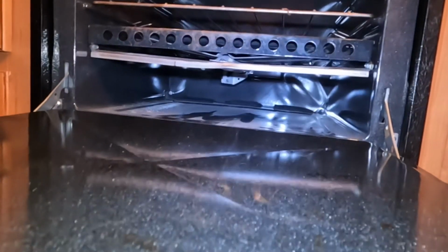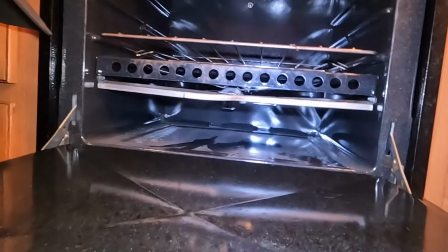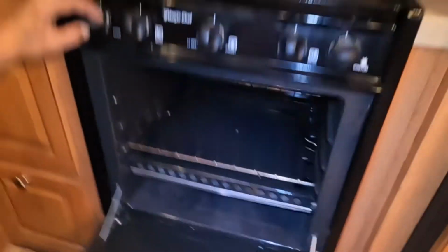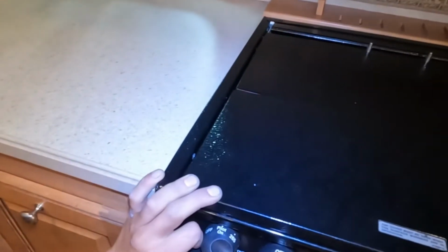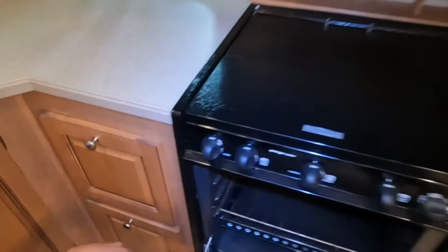So there we go. Once you get it going, you just want to hold the knob in for another couple of seconds. Then you can release and that flame will hold itself. Turn up to your desired temperature and she fires right up. Once you're done, just turn it back down to pilot. It'll hold just the pilot light for you. But if you're traveling or leaving the unit for a while, you just want to make sure it's right off.